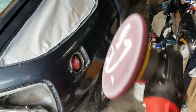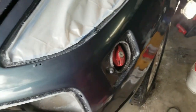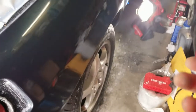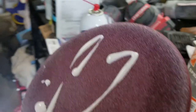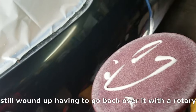I'm out here in the garage using the DA to do some polishing on the car after I wet-sanded it. My first time painting it, and it was kind of humid and hot, so I got some orange peel. I wet-sanded it with 800, 1000, and 1500 grit. I went around this section up here with the little orange pad on the power drill and it came out looking like glass. So I go start with the DA using the most aggressive cutting pad from the set I got, and you could still see sanding marks — it just didn't look great. But I used this Meguiar's complete foam pad I bought, and it's cutting a lot better. Same compound — same Meguiar's 105 — but the pad makes that much of a difference. Sure, that ain't news to most people, but it is to me.